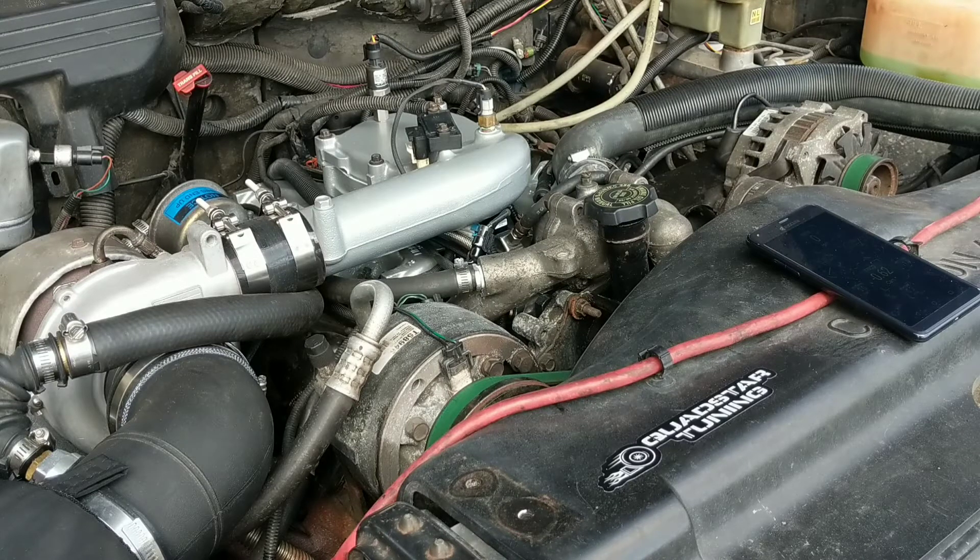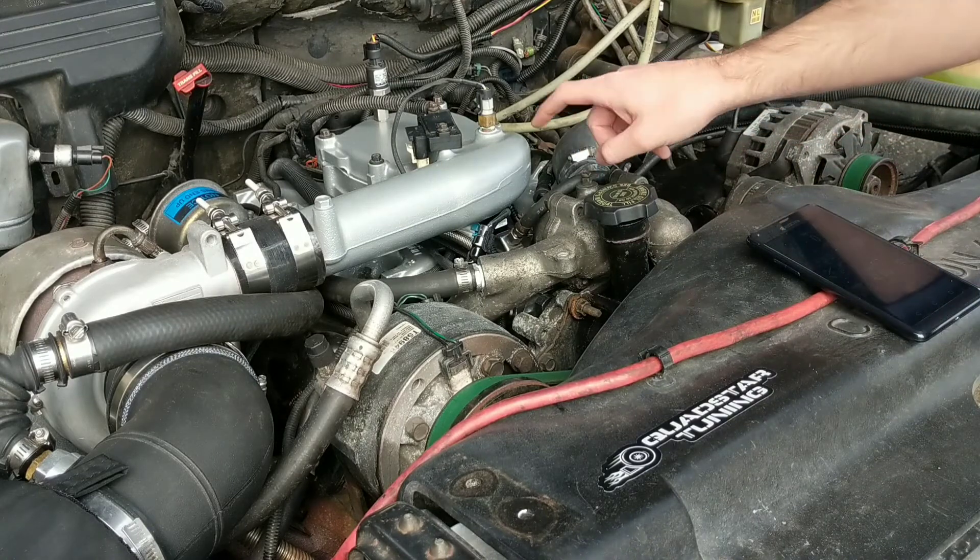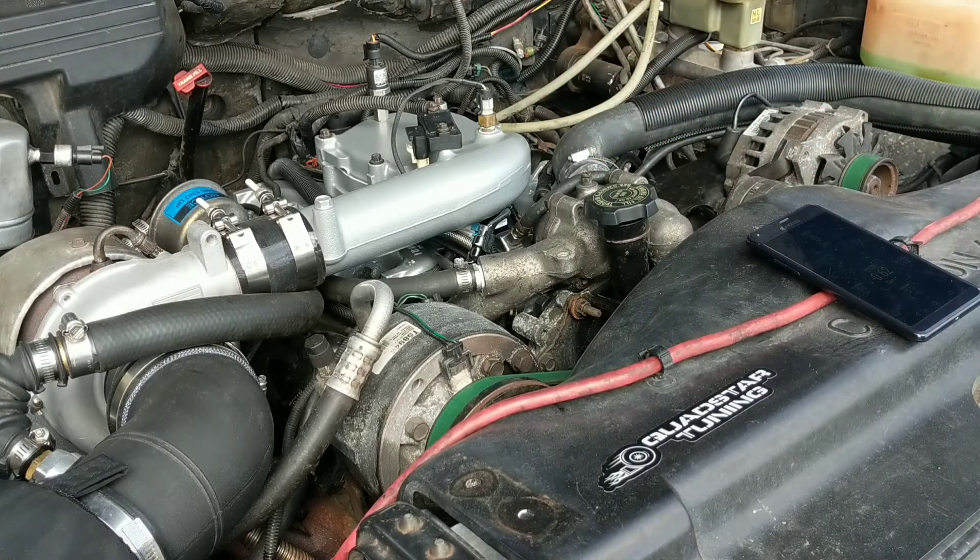We're not going to want to set it when it's totally cold — we'll want to run it a little bit and get some heat in it. But we don't want to wait forever for it to get up to temperature. With the aluminum radiator in this particular truck, it takes a while and you have to drive it around. Now we can lock our timing in within a matter of minutes. It actually does have a new injection pump on it, so we're going to use this here today.